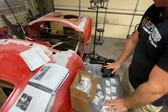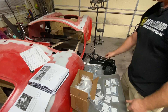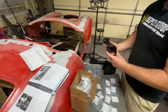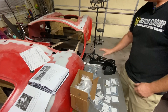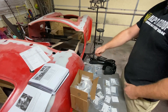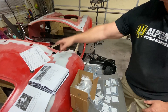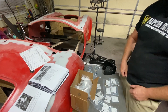With the Factory Five kit we've got everything we need for the traction control. This bracket mounts to the Mustang 8.8, which we'll do in a minute, and the upper control arms — these actually just came in yesterday from Factory Five. But I realized we took the bushings out of the 8.8 rear end, so I got to order new bushings. We also got all the hardware for the quad shock including restraining straps. I need new quad shocks because the old ones were beat. Doing a check, laying it out, going through your manual — you verify everything and we got enough to get started.